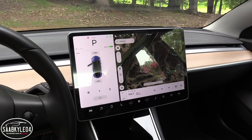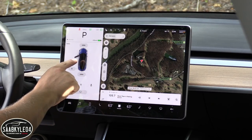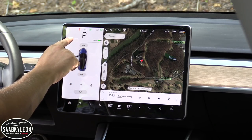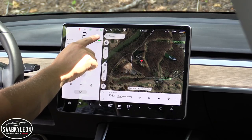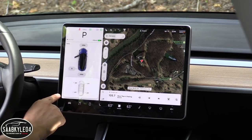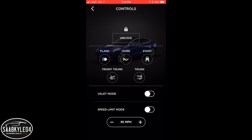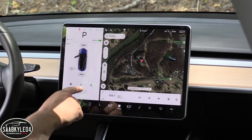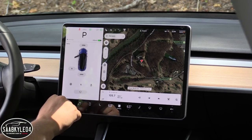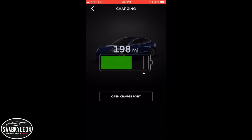The vast majority of the car's features are routed through this screen. On the left-hand side, a car icon lets you pop the front and rear trunks and open the charge port when sitting still — but once you're moving, it shows the proximity of other vehicles around you. Up top is a gear indicator and your speed readout. At the very bottom, there are menus including a trip computer and a tire pressure monitoring system. In the middle menu, you can bring up the rear view camera, check charge status, activate voice recognition, and control your wipers.